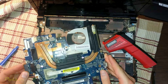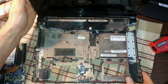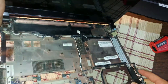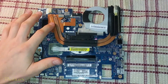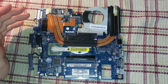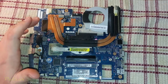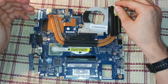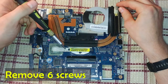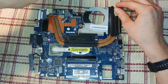There we go - this is the motherboard for the laptop, a little tiny one, and there is nothing left on the laptop except for the monitor. We've got it completely disassembled. Now let's go ahead and remove the heat sink. Some laptops don't have such a big heat sink because they don't have a dedicated GPU like this one does. There are six bolts and they're all marked, so you have to follow a certain pattern - start with number six, go to number five, and so on. When assembling, just go in reverse order.